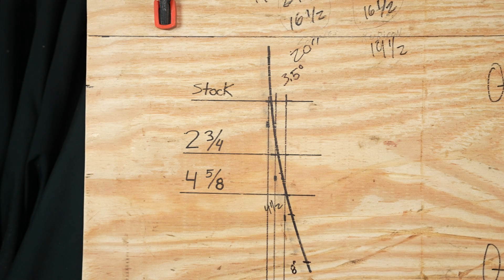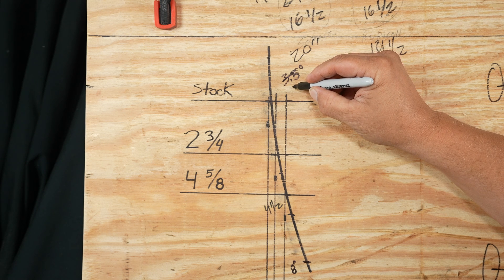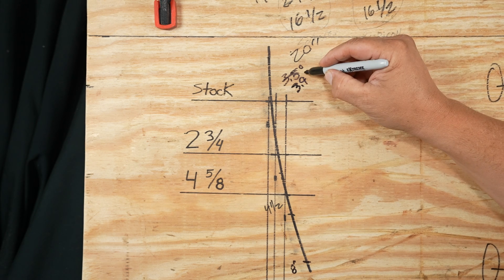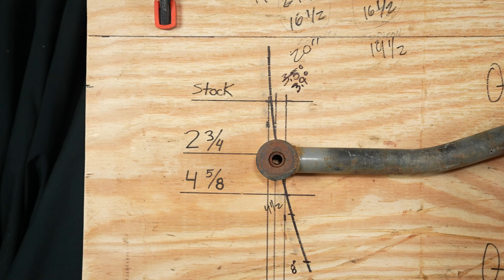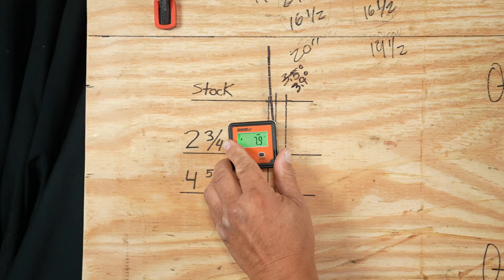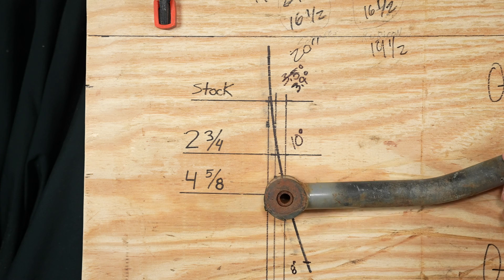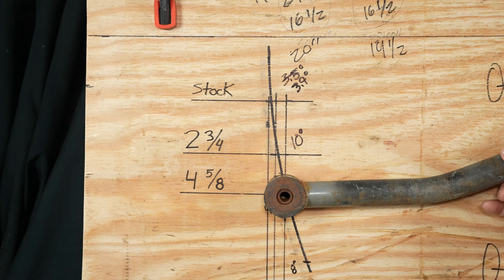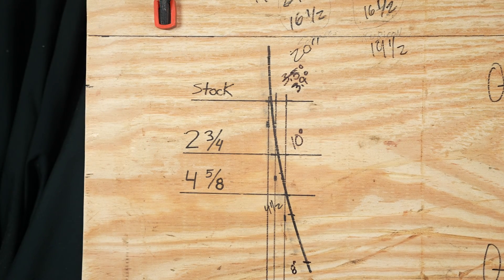At stock height it's closer to 3.9 degrees. Let's go down to the three-inch area — this is the area it's going to be riding. I'll say about 10 degrees there. Coming down to the four-and-a-half-inch crowd to see where they're going to be living — that's 13 degrees.